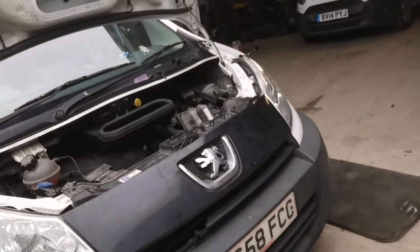Basically the steering just went really heavy, stop sign came on saying stop - power steering malfunction. We fitted a brand new pump from ASC, put it on, still nothing. So we did a voltage check at the pump before ordering the new one, and everything seemed all good.